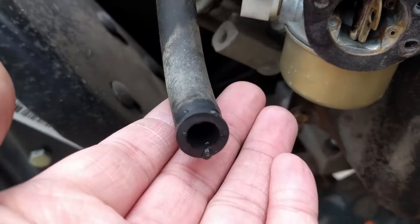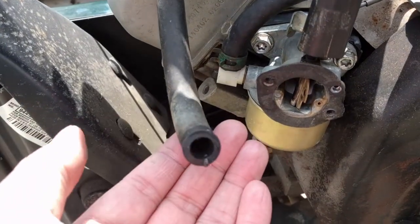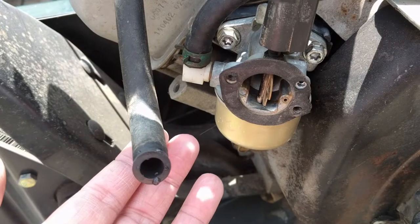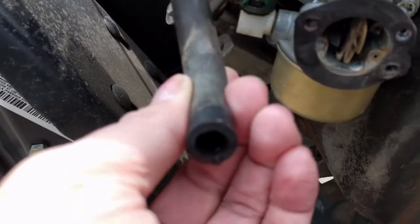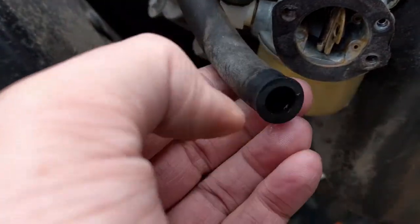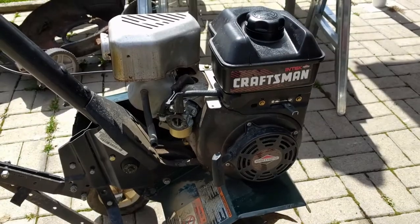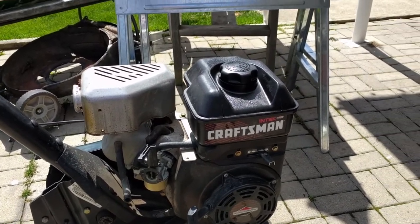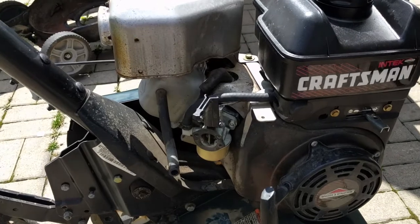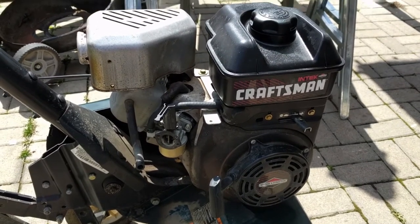I've never seen this before — this guy's got water in his oil. The overhead valve breather tube goes into your air box. I was running this engine and all of a sudden there's liquid coming out of the air filter. I had assumed it was gas coming out of the carburetor, maybe the float was stuck, but you can see — those are water droplets, and this was pissing out like a hose. We're going to have to drain the oil, drain the gas, drain everything on this thing and get it bone dry, because I think he left this thing sit outside, the float was stuck, so water and gas was getting past the carburetor and into the cylinder past the compression rings and down into the bottom end. So now there's water and oil in the bottom end.